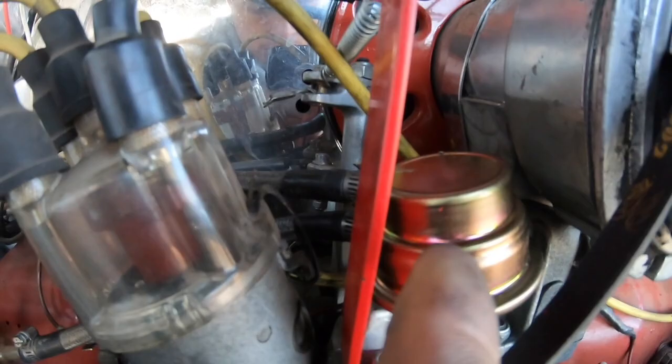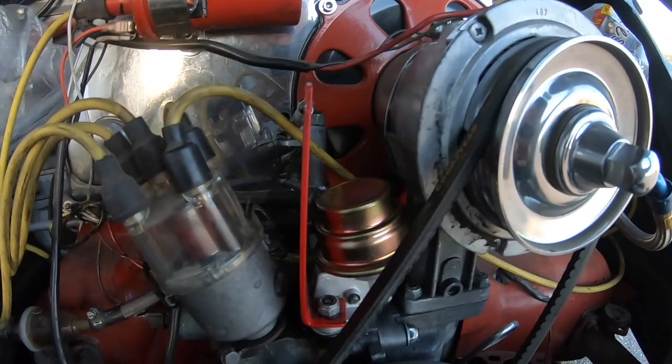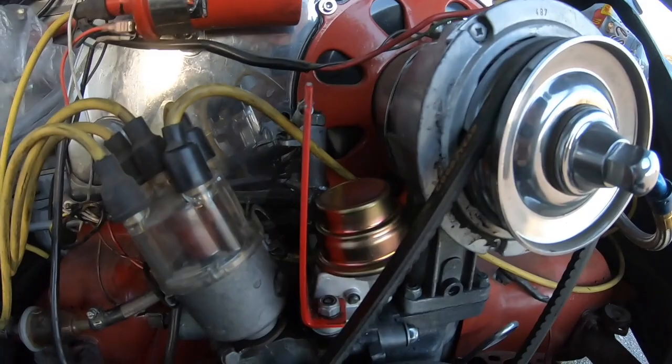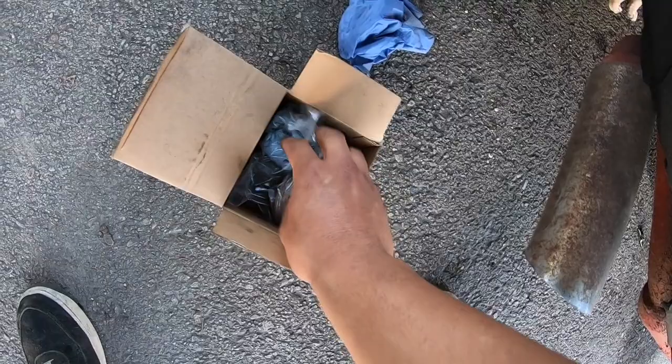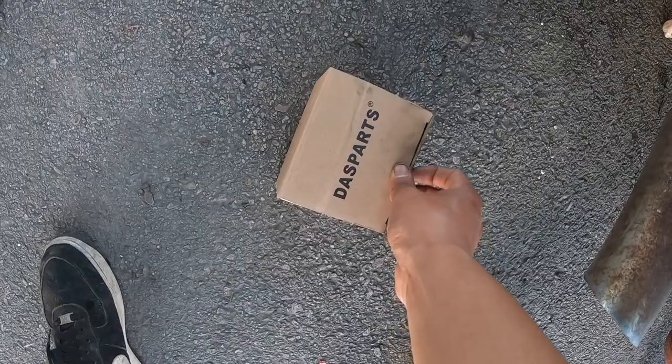New fuel pump is on. When I took off the lines there wasn't any gas coming out, so maybe the other one was shot or maybe he's out of gas. Either way, I'm gonna close it up for today and once my dad turns it on we'll figure out more — I'll give you guys another update. I noticed the old fuel pump didn't even have the rod in the middle — the little lever — it fell off as soon as I took it off, so that might have been causing the issue.